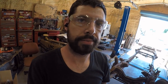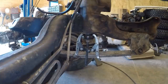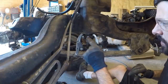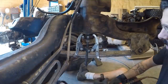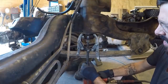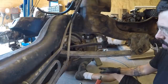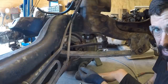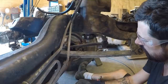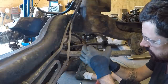So this is pretty simple, but just because something's simple doesn't mean it's easy. All we're trying to do is separate the pitman arm from the steering shaft. The problem is it's torqued on there pretty good and it's very old. Although it's not rusty, it's just on there real good. I'm going to strike it on the outside to shock the connection between the splines and hopefully start to break it free. I've got PB Blaster in there soaking, but none of it's making it to the bottom — it's totally sealed together.